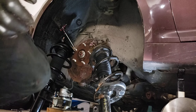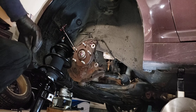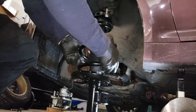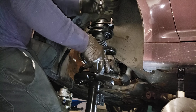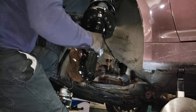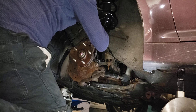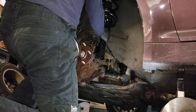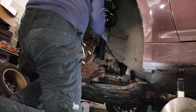Hopefully you can see because I'm not editing anything. Here's the old strut, here's the new one. Like I was saying before about this bearing plate — I'm going to put it up in there, hang it with one bolt nut on one of the bolts. I'm going to put some grease on top of this to help preserve it. Just line up the holes, make sure you're clear down here, line it up and start it level by hand like that.